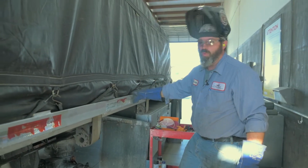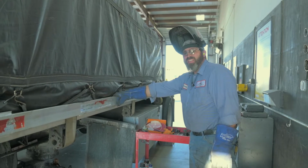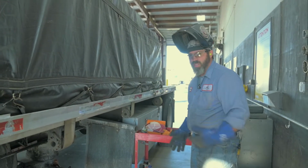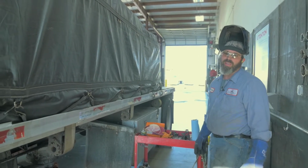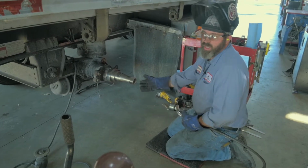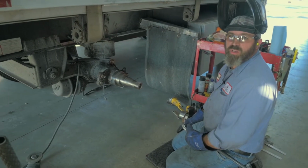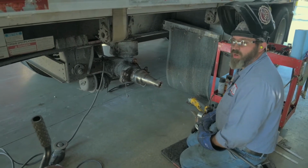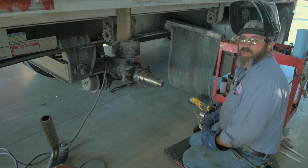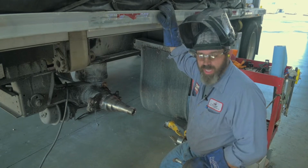It happens all the time, a whole lot more than we'd expect. We were just talking about it last time I was at Claremore, and they said that bearing failure causing duals to actually come off the truck while driving down the highway is a daily occurrence in the United States. There's a whole lot of business out there, and just educating shops about replacing these spindles when they reach their maximum amount of wear, when the bearing journals reach tolerance, will prevent the catastrophic bearing failures on the highway. Unfortunately, half of our business is from catastrophic bearing failures such as that one right there.